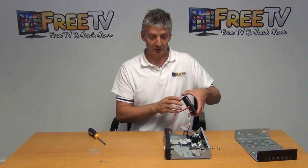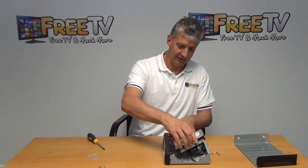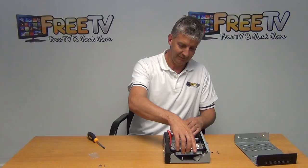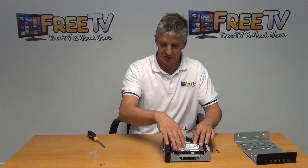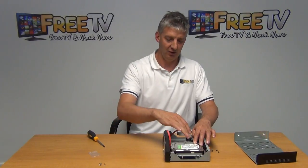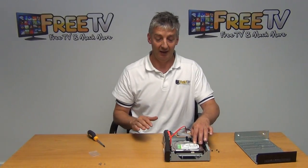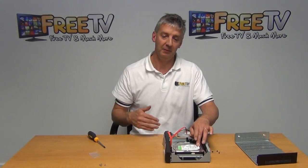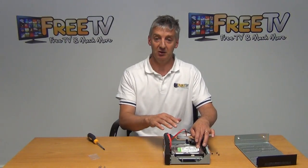Now if I actually powered up the DVR at that point, would it work? What we need to do with the final point is come along and slide this down onto the chassis, lining up onto the four screws, get the four screws we showed earlier, screw it down, and have the cables push down securely inside. Then just put the cover back on. The next step will be in the next video where we'll be formatting this. That's it — just physically how to install the hard drive into your AHD DVR.